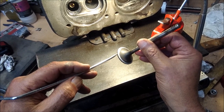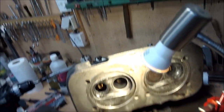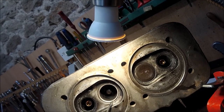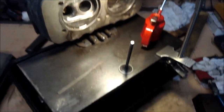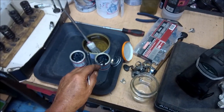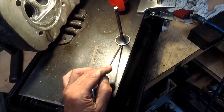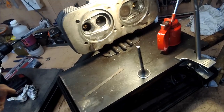A nice matte finish - the same width band all the way around is what's required. Here we see the valve seat - that's where the shadow was, that's where you could see it was still black and dirty. Now it's all been ground all the way around. That's the coarse paste done, and then because you're proud of your work, you're going to do it with the fine paste which takes out any little scratches.